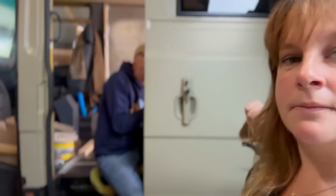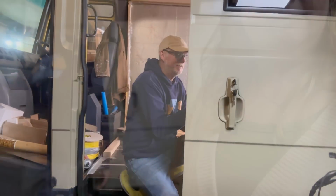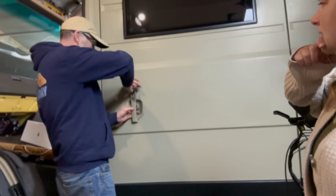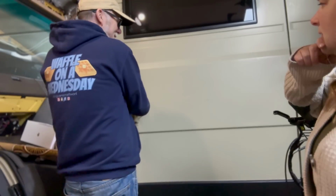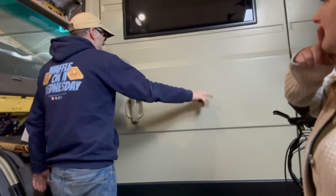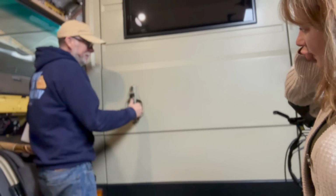Never mind. We can adjust it again. But the good thing is that we're testing it from every scenario, because the last thing we want is for this door to not open, for obvious safety reasons. So I've got to wind it out one more turn. Okay. He thinks he's done it. Lock it. Try and open it. And try and unlock it again. Because you've moved that lever, the rod doesn't go back far enough. Do it with the fingers inside.